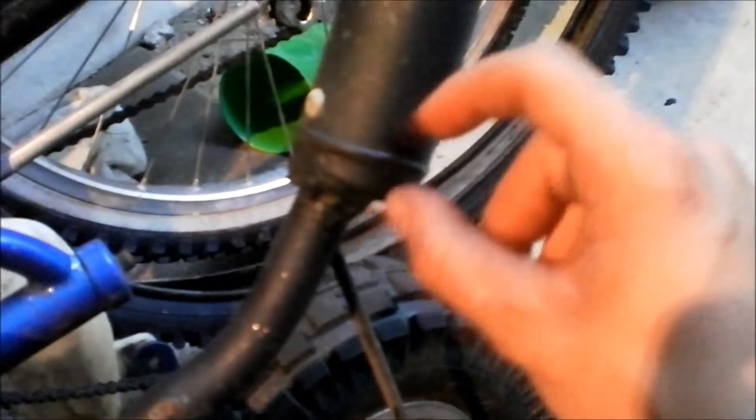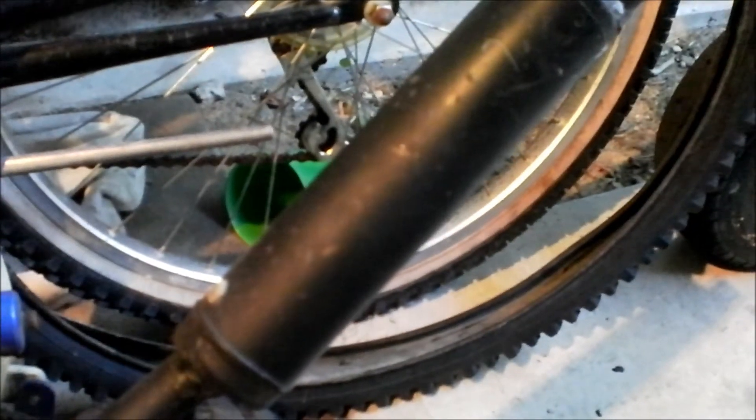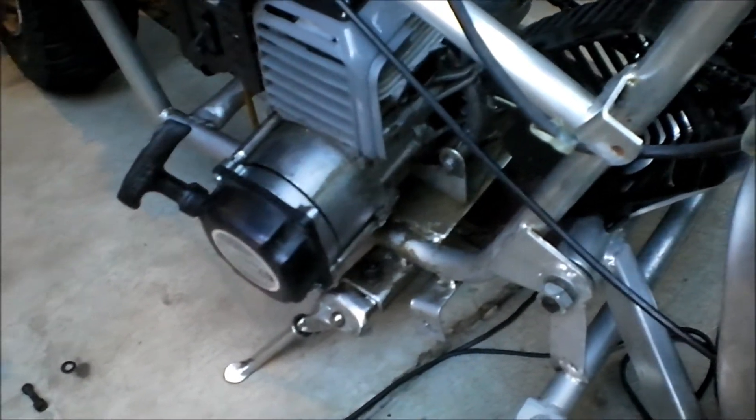On the scooter there's what I believe they call a catalytic converter — it's like a little honeycomb — and I've actually cut the baffle out of the center. It had only one pipe and that didn't let the gas out fast enough, so I drilled a second hole and welded in a second pipe, and now it breathes very well and I can get up to speed very quickly. As long as you've got enough back pressure so you're not going to blow it up, that's fine. Those pipes are a little bigger, but that's because that's a 49 to 51cc versus this which is a 41cc, so it needs a little more opening.